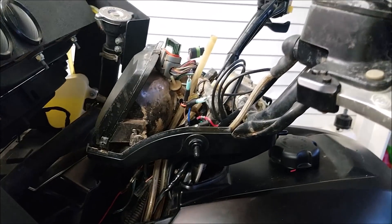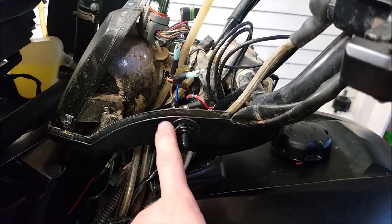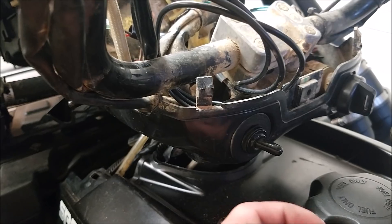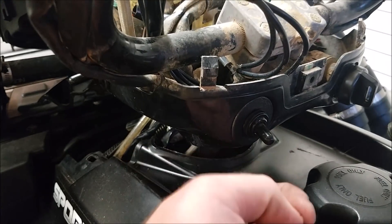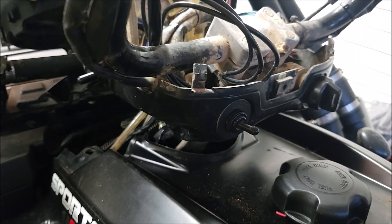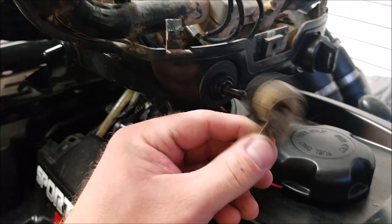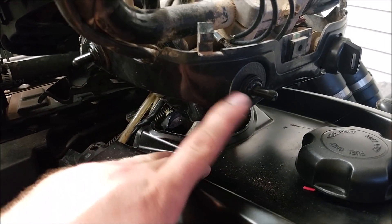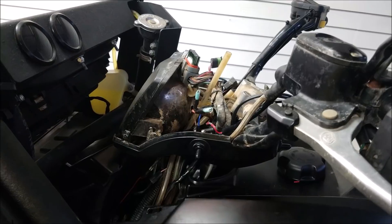Just a quick little side note: where I mounted this switch was just for the 12-volt accessory plug to go in there. I just took that out, painted up a quick washer, and used that factory hole. This is going to be my fan switch setup, so I can turn it this way for normal operation, and then I can turn it this way and it's 12 volts straight to the fan so it can never be turned off — but I can turn it on when I want. Say if you're sitting in line and need it to start cooling down, that's how you do it. That is with the factory diagnostic port plug for the EFIs — take that plug out, use a flat washer that's a perfect size for that hole, and now that is all there. No more drilling into places or making anything permanent — little tip.